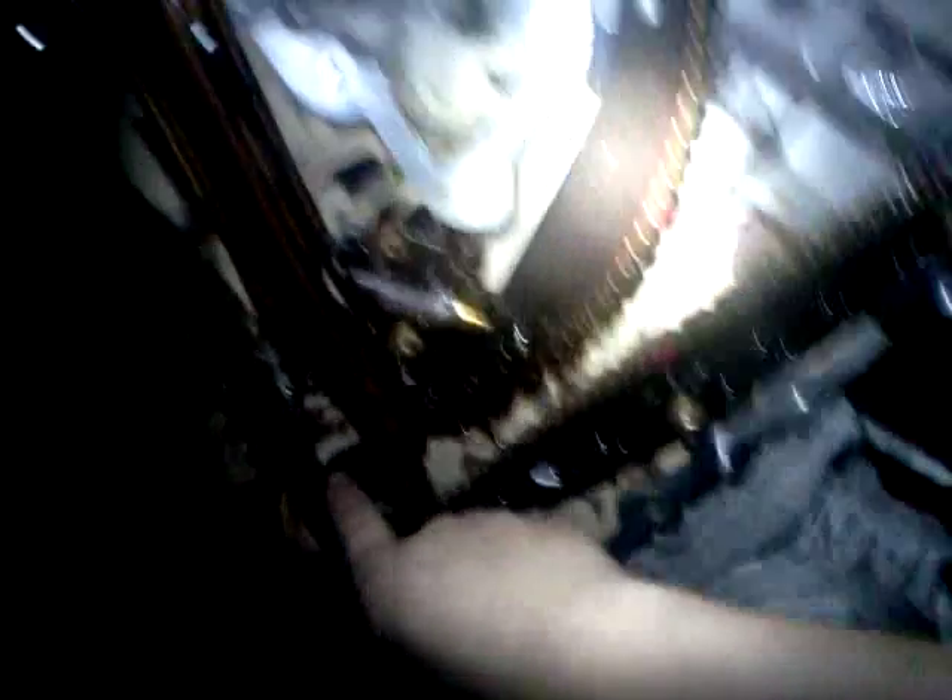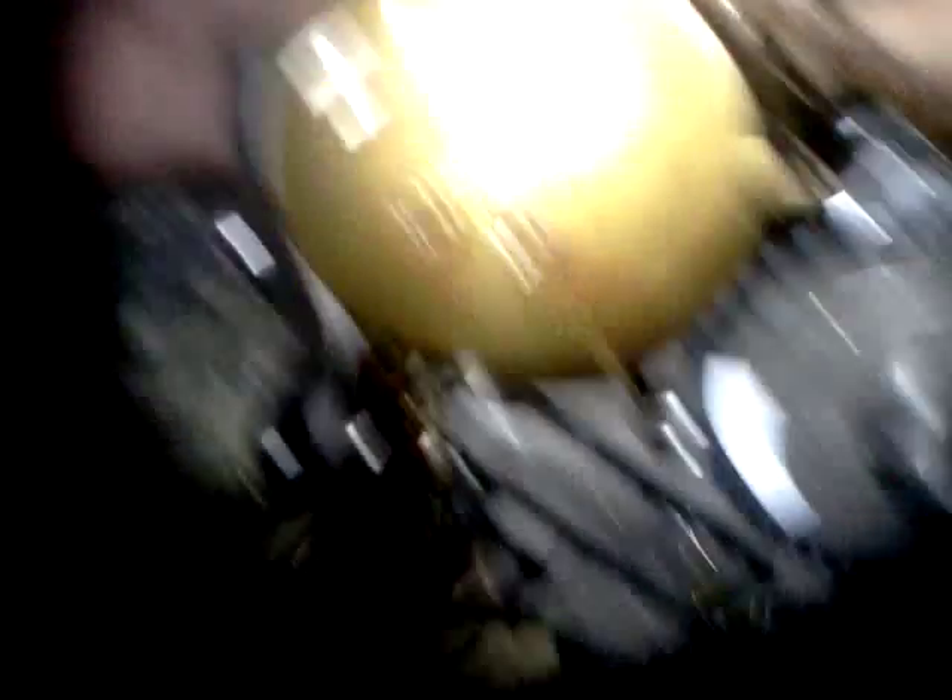I'm going to finish it on Monday. If you see here, you got your crank gear — it comes up, chain runs around this to this head. Your exhaust side and your intake side for the cams, running those valves down there. For Ford's variable cam timing, this right here is a cam phaser.